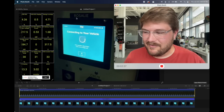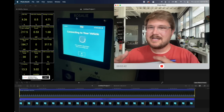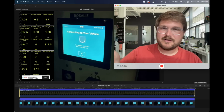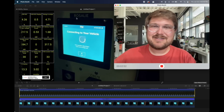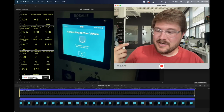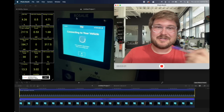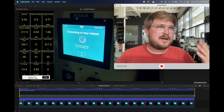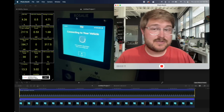It's a little bit of a weird situation, because I feel like most of the general public is just getting used to kilowatt numbers, going to a 350 kilowatt charger or a 150 kilowatt charger. The problem is it really depends on your vehicle type as to how fast you're going to charge at each of those individual chargers, not the charger. And so in the case of the F-150 Lightning, you actually need a really big boy charger in order to reach high speeds. And I think the best case in point of that is the 125 kilowatt branded ChargePoint CPE 250 units that we use for our range test.